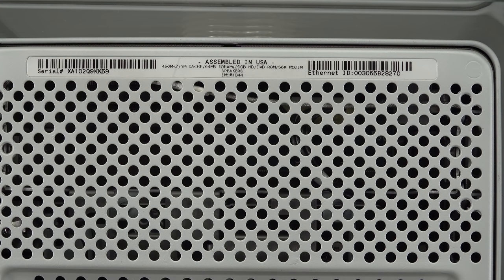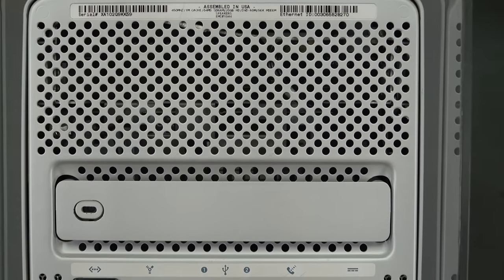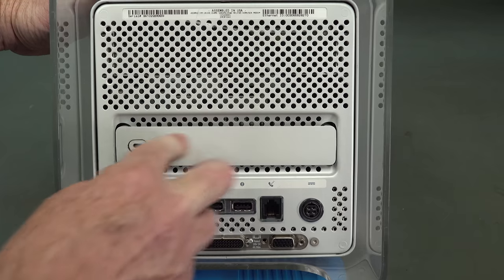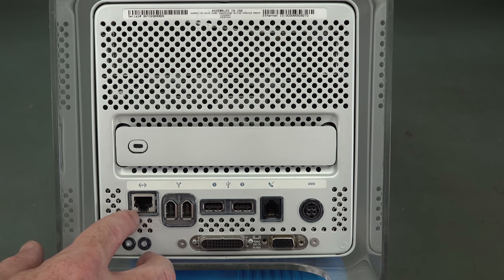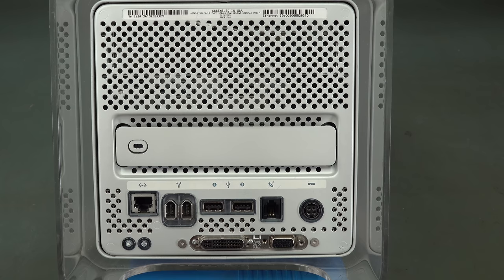Beautiful. This model is the 450 MHz one, so this is the lower-end one. The higher-end one was the 500 MHz model. One meg cache, 64 meg of RAM - so this wasn't the fully optioned-up one. This was the cheapskate $1,799 version. But that fantastic pop-out handle - look at that. With the Kensington lock as well. We've got ethernet - I believe you could get a one gig option, which was stunning at the time. Dual FireWire interface, dual USB - but it actually has more USB ports than this, as I'll explain in a minute. And of course, classic modem interface, because we are talking about the year 2000.